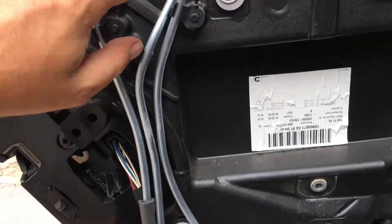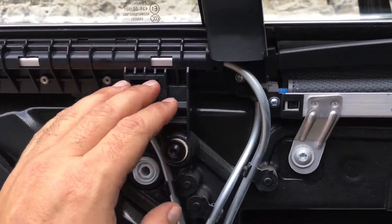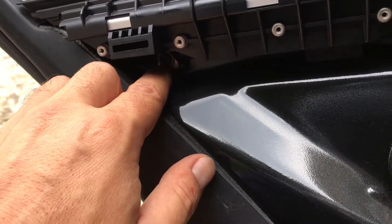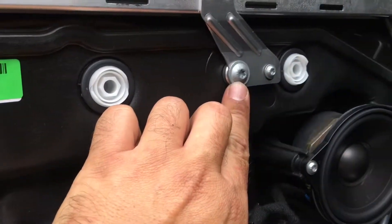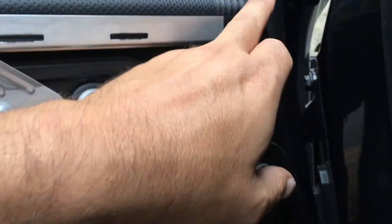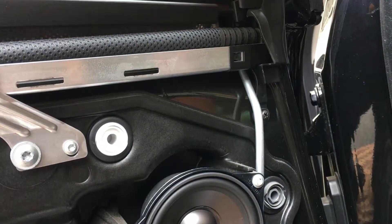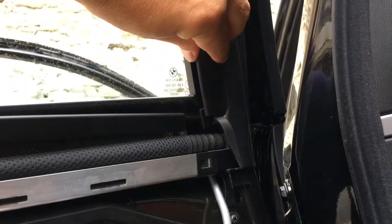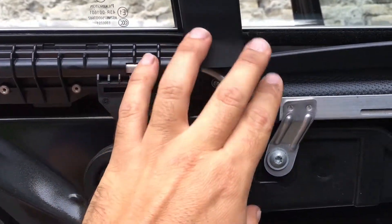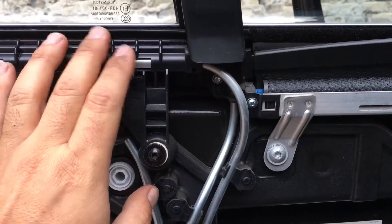This is the electric line that powers the shades. The shades are clipped with this screw — you don't have to remove this one — Torx 30 or 25. Unscrew this and you have to remove this plastic very nicely and gently. Put it on the side and slide it upward. Be careful about this piece — this is one piece, and this is the second.